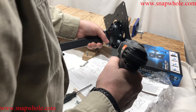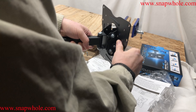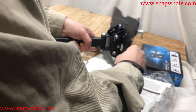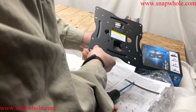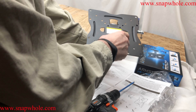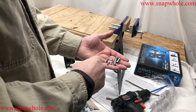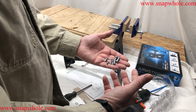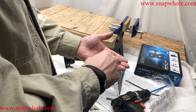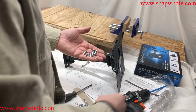Not likely to slide off, but it's possible. So you loosen these and you can see that provides tilt. I'll leave that alone until I mount it. It's a universal fit — you just find the hole pattern that mates up with your TV. There are three different sizes of screws because there is no standard screw size for TVs. Find the four screws that fit your TV, match up the holes, and mount it.